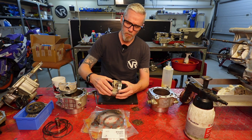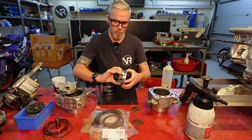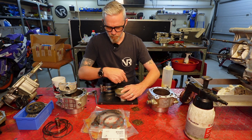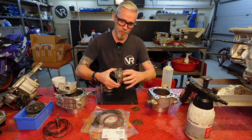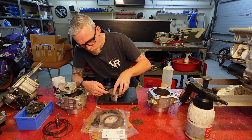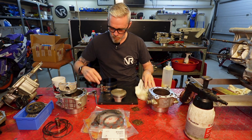So there's the split for the oil ring there. We'll put the second ring in at about a triangle kind of shape here, and we'll do the third ring around this side. This oil does make it really, really thick, which is good. So top ring splits here, second ring splits here, and our oil scraping ring splits here. So they're all nicely separated. It's never going to be a clean job.